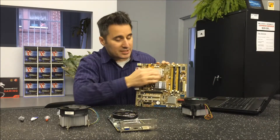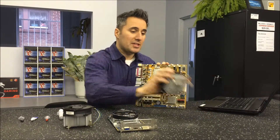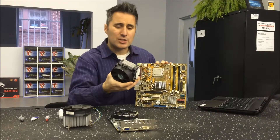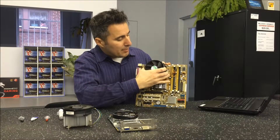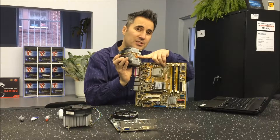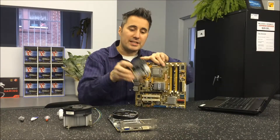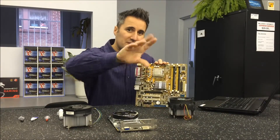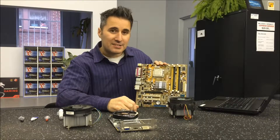So what would happen is that processor gets smoking hot — you could actually fry an egg on this thing. So what you do is you take this, or preferably this one — this one's copper. Copper is good because it actually has a great transfer capability. You normally put that on top of the processor and it makes contact with it. When that processor gets hot, the heat gets transferred to this little copper tube, the aluminum heats up really quickly, and then that fan jets out the hot air out the top. So it's called an active cooling system — it's actually blowing the heat away from that processor.